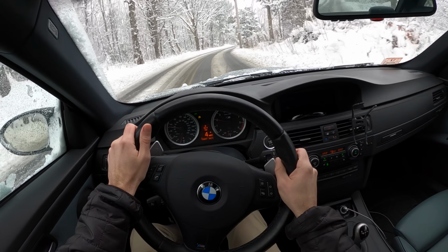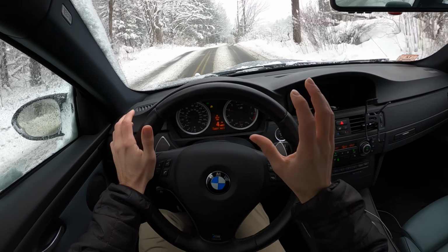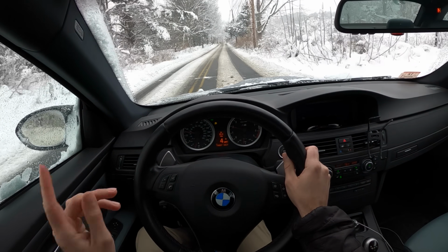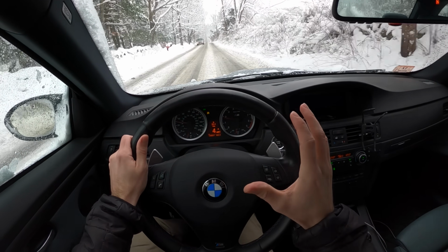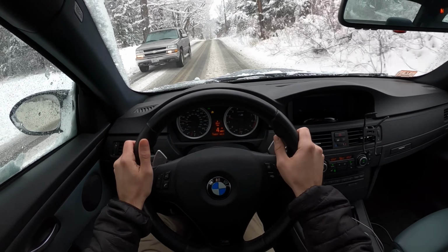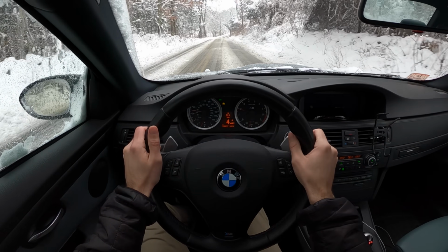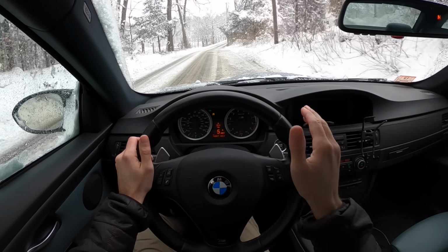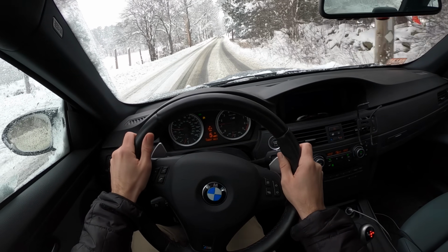The snow is fun too because you get to do all this stuff without really abusing your car. You do have to look out for a couple things. So, number one, yes, it's cold, but if you're just revving the heck out of your engine, you're not moving that fast. So there's not a whole lot of air flowing, which means you can still overheat your car if you're just revving, and you're only going like 10 miles an hour. It can be a lot of fun, but you can still do some damage.